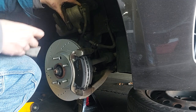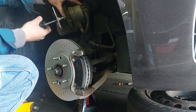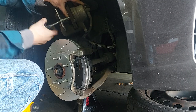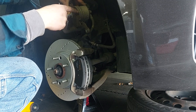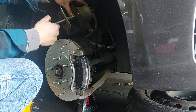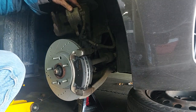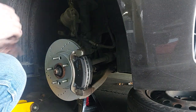Not using the C-clamp today - using the proper piston wind-back tool. It was in storage. It pushes back nice and smooth - just a little twist and it's pushing the piston back fine. There's no crumpling of the rubber boot. A lot of places with rust build-up you want to take a little pick and make sure this boot isn't crumpling up and tearing because that'll become an issue later on. If it pushes back smoothly, that's one way you can tell your piston and caliper are just fine.